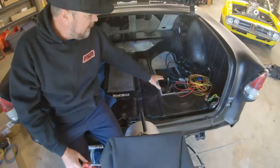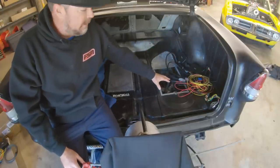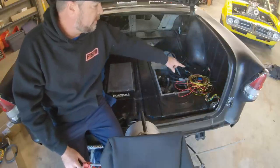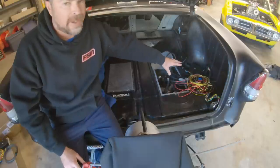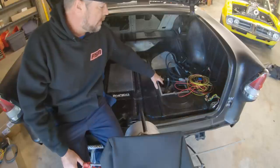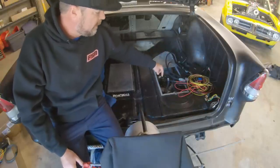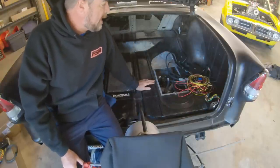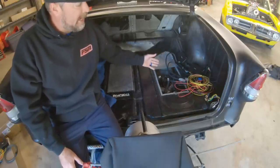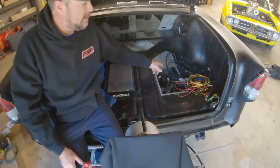Anyway, this trap door, which is not on here, this is where the 5-gallon race cell lives. And there's a Holley, now brushless, pair of fuel pumps in here with two controllers, and you'll see they're just kind of shoddily zip-tied and wired in there. That's because I replaced the non-brushless pumps, they were two 450s in this module, with these two brushless pumps that are built into this module that just drops in. And then I just quickly wired them into the Holley Dominator ECU. They're wired up staggered. So one is on at idle, and the moment this thing sees about 30% throttle position, the other pump turns on.